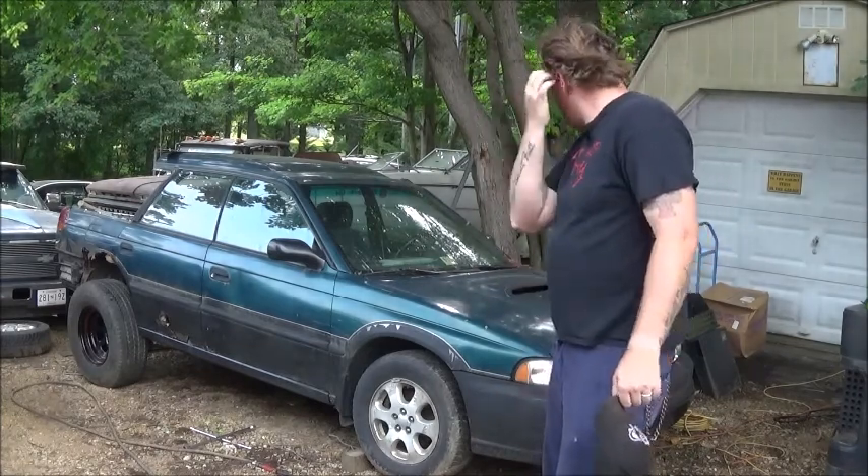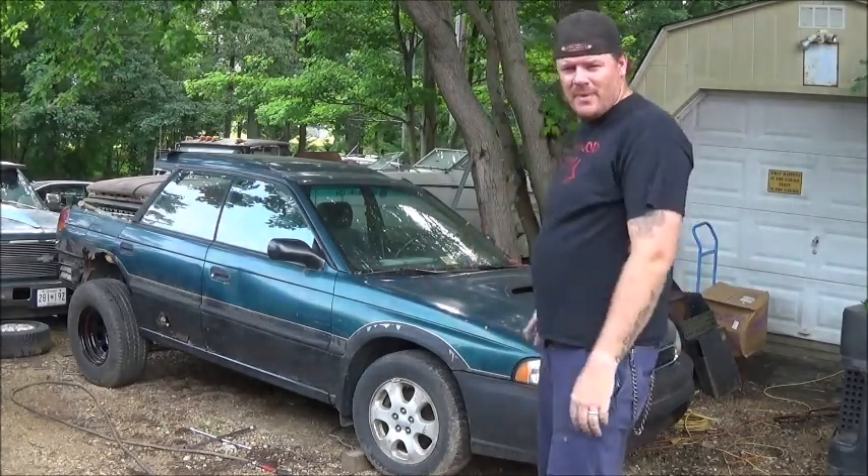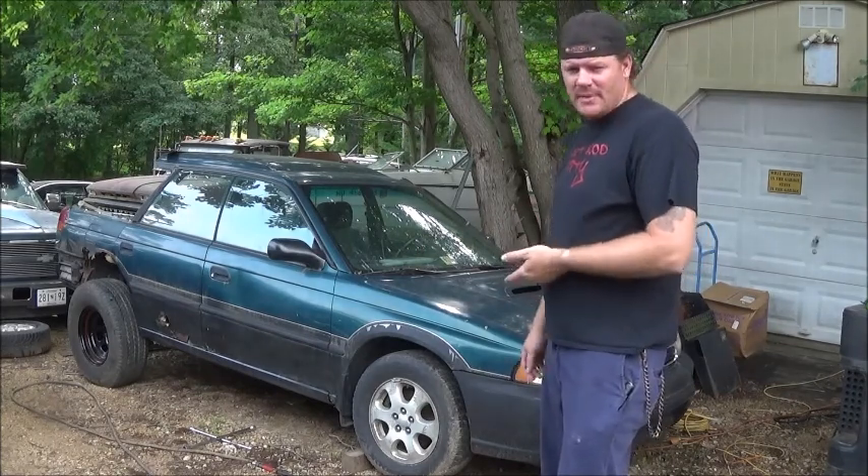So I've got to get the front of this jacked up. I'm going to lift it, we've got to cut the fenders out, rip the front bumper off. I at least want to build a front bumper for this thing, possibly a rear. We already have the straps — the only thing I'm missing is recovery hooks. The rules call for them to be attached to the frame, but this is a unibody car, it doesn't have a frame. There are some frame rails, but they're just sheet metal and tin, so I'm not 100% sure how I've got to go about that, but I'm going to figure it out.